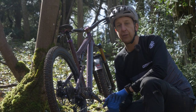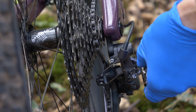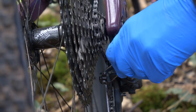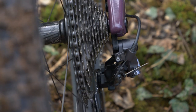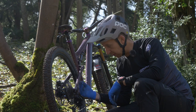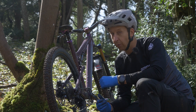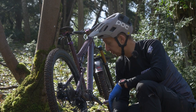This isn't really a direct how-to — it's just how to deal with this situation because it will happen at some point, and preferably you want to ride home. If you struggle with it and don't want to risk snapping the mech, use those limit screws — they're surprisingly useful. It might mean you get just a single gear or a gear or two. You can also use the barrel adjuster on the shifter to screw in cable tension and hold the derailleur in position. All you need is one gear — something middle of the block — and hopefully you can ride back out.